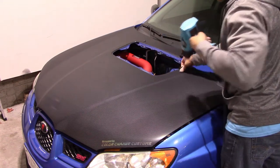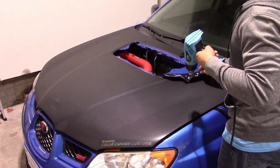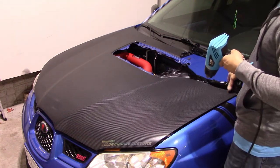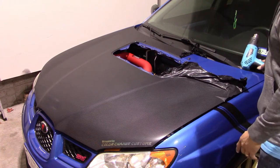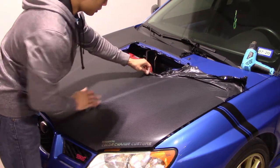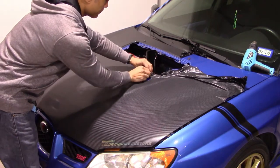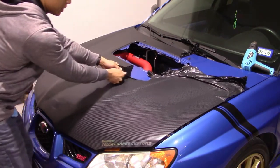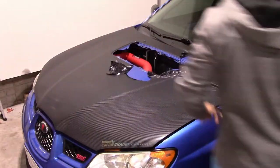Just heating up this area, getting a broad area so I can peel more vinyl at once. It's releasing very nicely and smoothly as long as the vinyl itself is warm. Let me demonstrate what I mean by vinyl breaking when it's cold. This area here is kind of cool - I'm going to try to pull it. There's glue residue leaving right there, and it's tearing already. Instead of pulling off cleanly, it's going in its own direction. Definitely not pulling off as nicely as the area that's been warmed up.